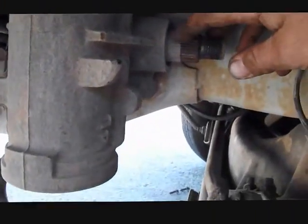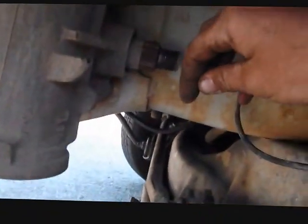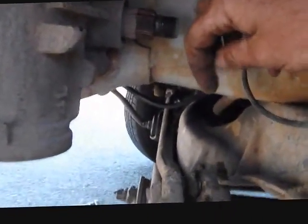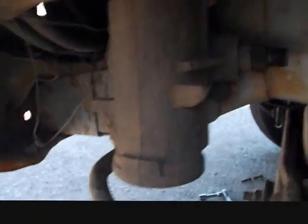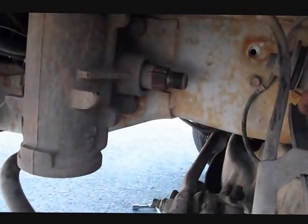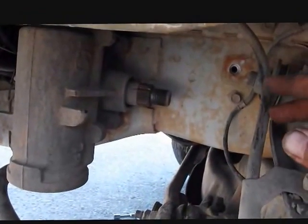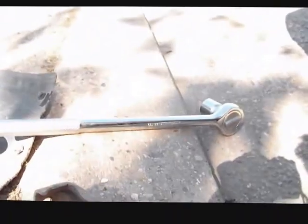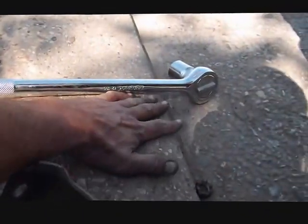When you put it on, you want to make sure your grooves are lined up, as well as it lining up with your cross member. Cross tie member, cross, whatever that thing's called these days. This one going all the way across. So now what we're going to do is line it up and get it back in place. We'll tap it in a little bit to get it started with the baby sledge without damaging the threads, and then we'll use the big bolt and the giant 3/4 inch ratchet. There's your little size reference, to get it back on there.